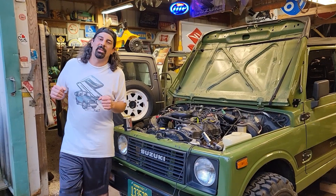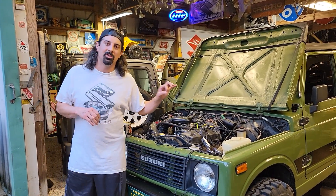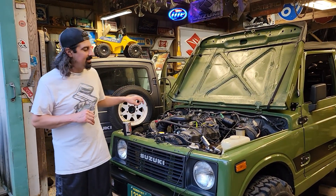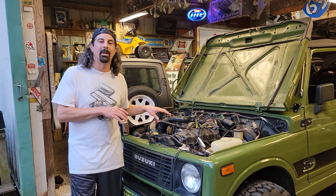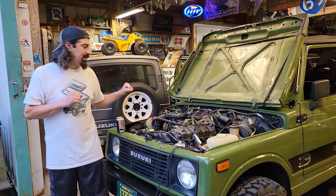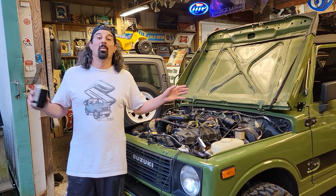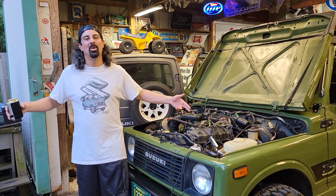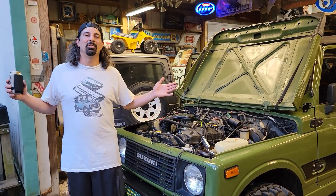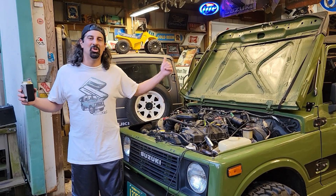It's just that simple to time your Suzuki Samurai carbureted engine — and I repeat, carbureted models only. If you have a fuel-injected engine, we will do another segment on that where you will have to stick a paper clip in the diagnostic port to freeze the computer so it does not make adjustments while you're trying to time the engine. That is really the only difference between the carbureted and fuel-injected Suzuki Samurai and GeoTrackers. Hopefully we got the information across to you — check out our other videos below, subscribe to the Highway 83 YouTube channel, and check out the Highway 83 Suzuki website online store — free shipping. Thank you guys!